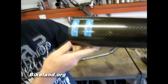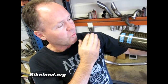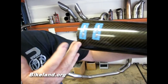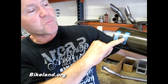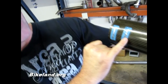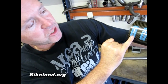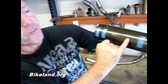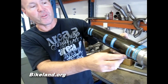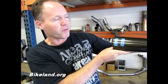Exactly. We know we can make power and all that — pretty much standard deal. But what we did here was our heat cycle testing, from the beginning of the muffler all the way back to the tip. You can see with this particular test, when it turns black, that tells you the temperature. On test two, this was 320 degrees Fahrenheit. On test one, where we changed a few things, it was closer to 280 degrees. Further up you see some went above the strip — 360, 280, and so on.